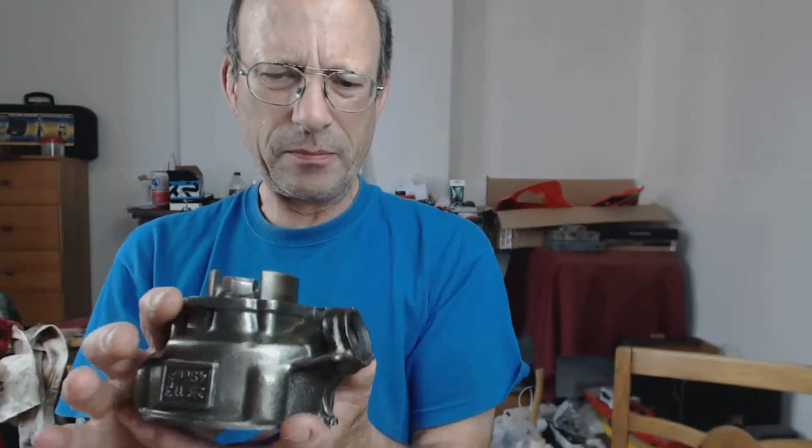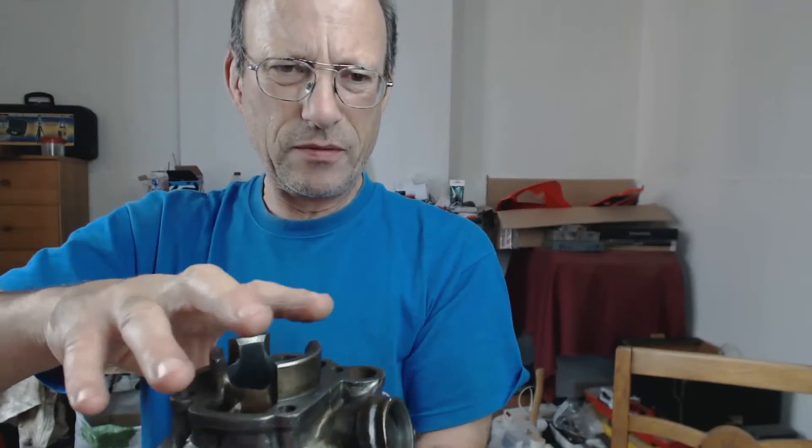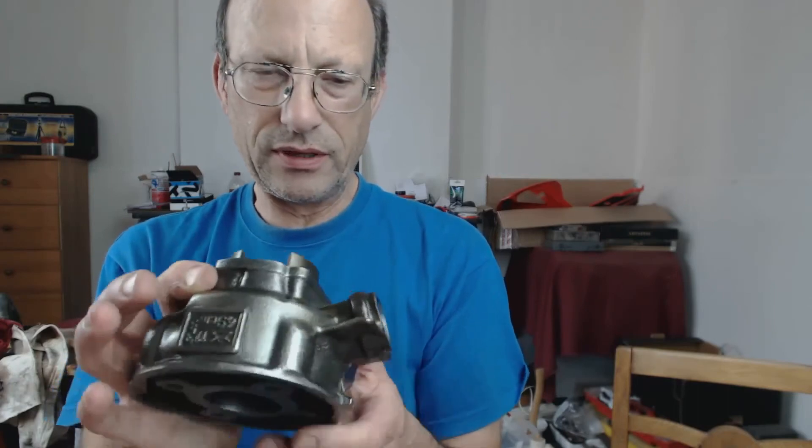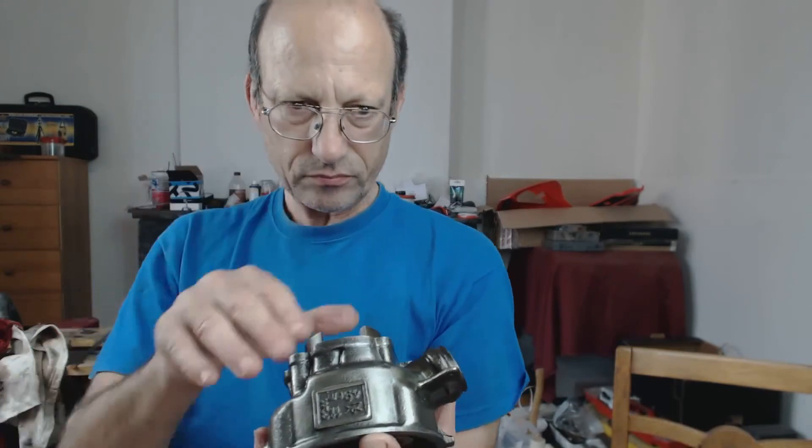Just carefully breaking the glaze. When finished, it's critical that you wash off. I put it into a tub and poured over some old fuel recovered from the petrol tank — it stinks terribly, but get it fully bathed and keep it moving in the fluid so it gets all the carbon, powder, grit, bits of metal and cast iron washed off. At the bottom you'll have a black residue of carbon, grit, bits of sandstone and everything. It's absolutely critical that you give it a good wash off in petrol or even paraffin — just get something to clear it off. And there we are, it's ready to go on.